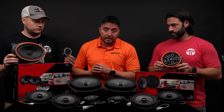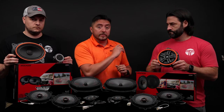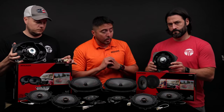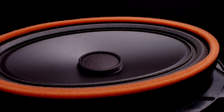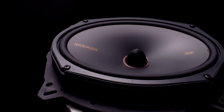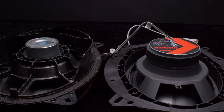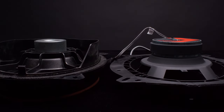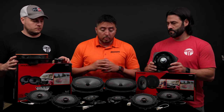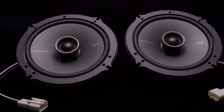So one of the things you're seeing here is your factory speakers — your dash speaker, your 6x9 in the front door, and then also your 6.5 which is your rear door speaker, and then also your tailgate speaker. I'm going to ask these guys to flip those around so you can actually see the build quality. Starting with the front doors — our speakers actually have a much larger magnet than the factory speaker. This allows the speaker to play a little bit lower and handle more power, whether it's a JBL system or non-JBL system.